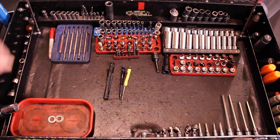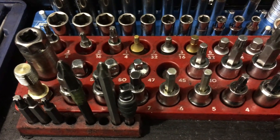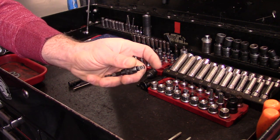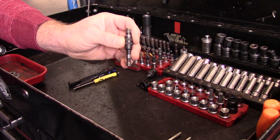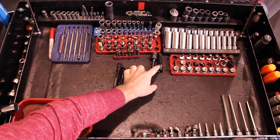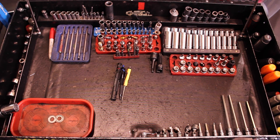A Sharpie marker — an important part of every toolbox. More quarter-inch drive bits, the short T-bits. Two Phillips heads — I always have a backup because undoubtedly throughout the day I'll lose one. This is a really great quick-connect locking quarter-inch drive extension tool from Snap-on. I absolutely love it. It comes in a set — this being the shortest and then some longer ones. These two sockets are an 8-millimeter Allen and a 14-millimeter Allen for doing DSG services. Everything in this roll cart is meant to be efficient and quick for the majority of jobs throughout the day without running back to my toolbox.